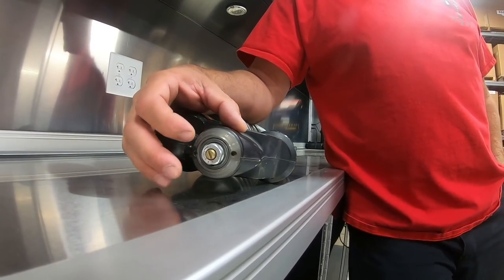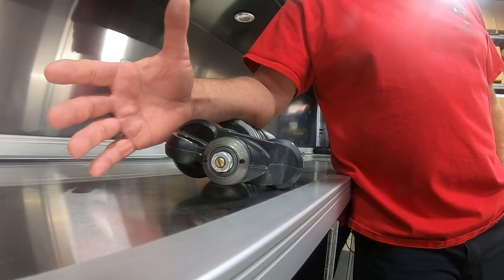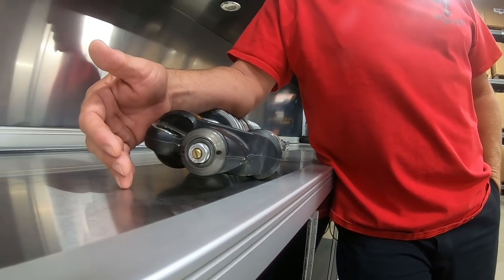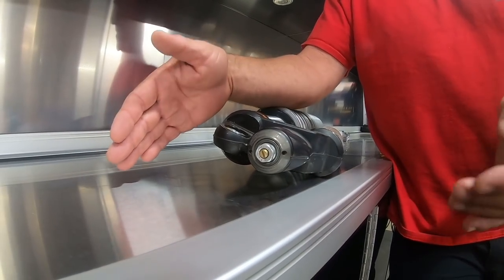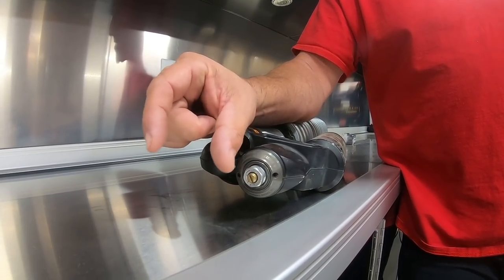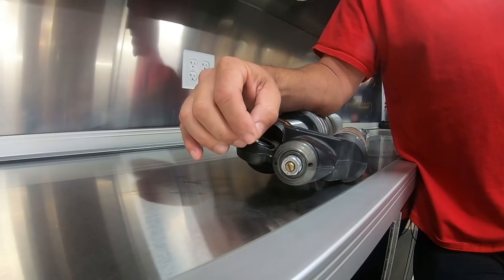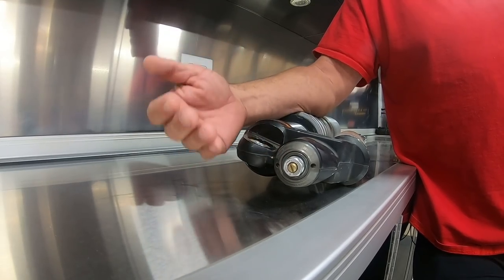What does high and low speed do? Speed is not related to you driving fast — speed relates to how fast the shock shaft moves and how much oil it moves. High speed is moving the shock shaft a long distance in a short amount of time. Low speed is moving the shaft a very short amount, regardless of whether it's fast or slow, like chops and whoops. High speed is big hits, big jump landings, big G-outs, things that are going to bottom the car out, a lot of weight in the car — high speed typically will control that and stop you from bottoming out.